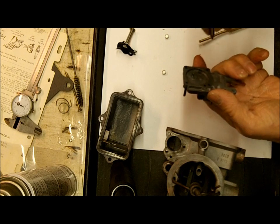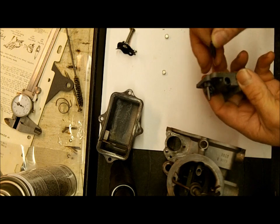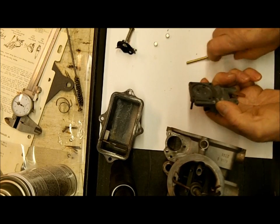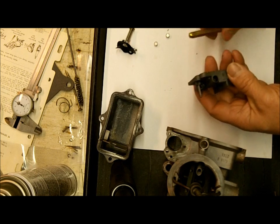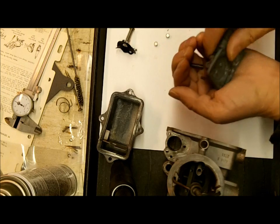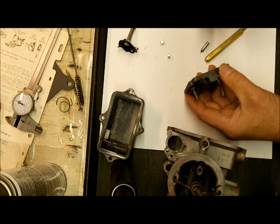The next one is the outlet side. You've got the diaphragm full of fuel and when you press the gas it shoots through this hole into this well. The check weight sits here so that when you're sucking in gas the check weight is closed, keeping fuel flowing only one way. You can do the same kind of test — put a little soapy water in there and blow through this hole to see if you get bubbles coming out. Tap it a few times if needed, again being careful not to hit it too hard. A little silicone spray lubricant helps these move freely.